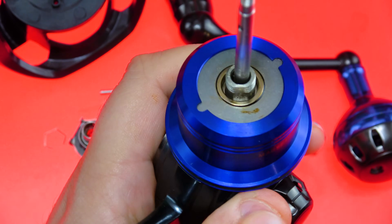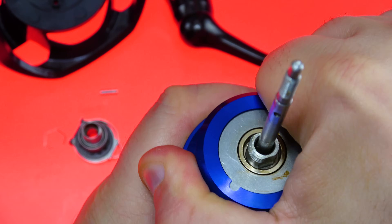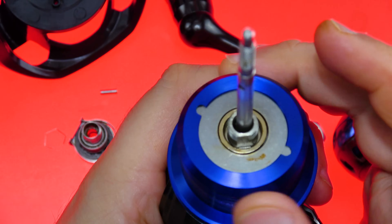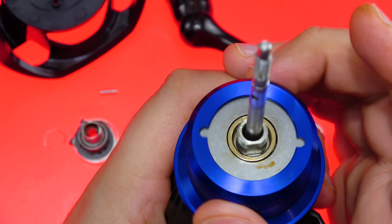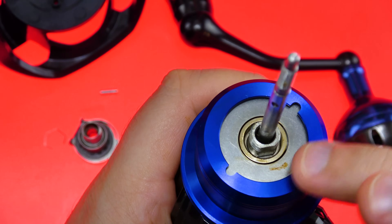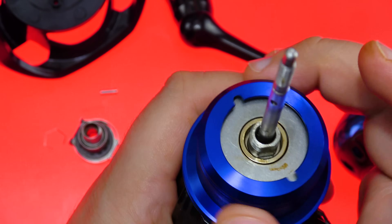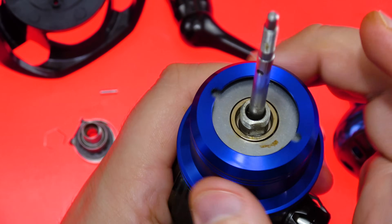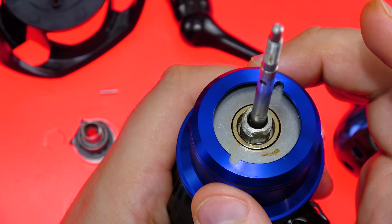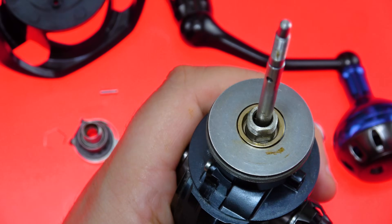What you're going to do now is take this blue cap and counterclockwise slowly unscrew it. You don't want to go too fast because if there is any buildup or bleed of the ferrofluid or any grease that's in there, you don't want it to lift out the magnet unit prematurely. So once we've got it fully unscrewed, we're going to gently lift it up and out.